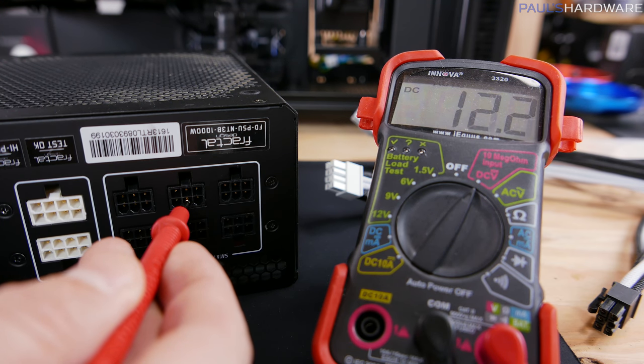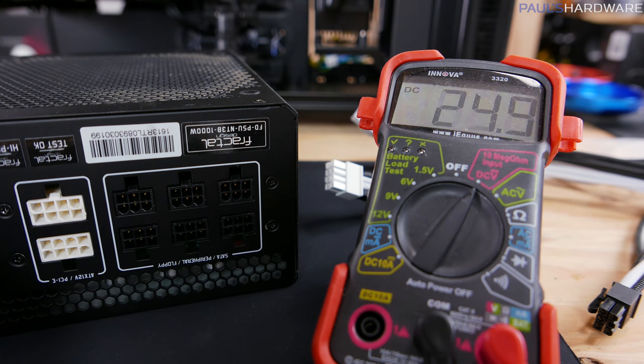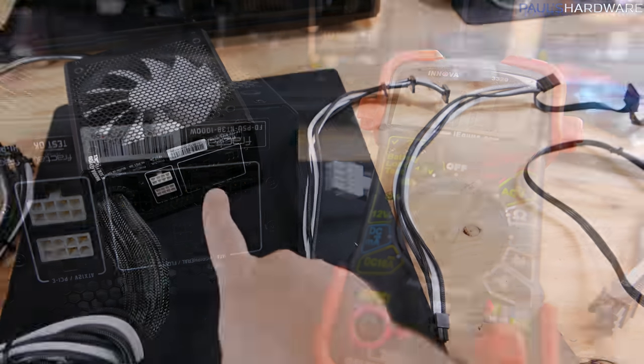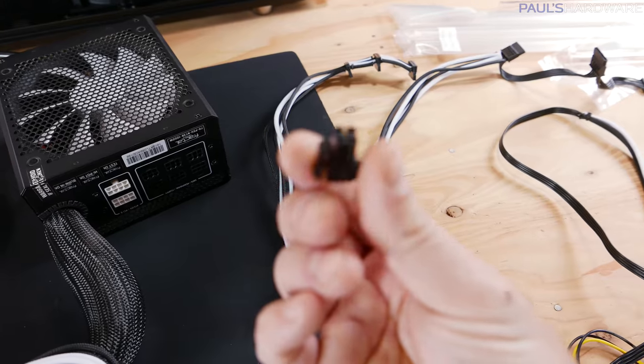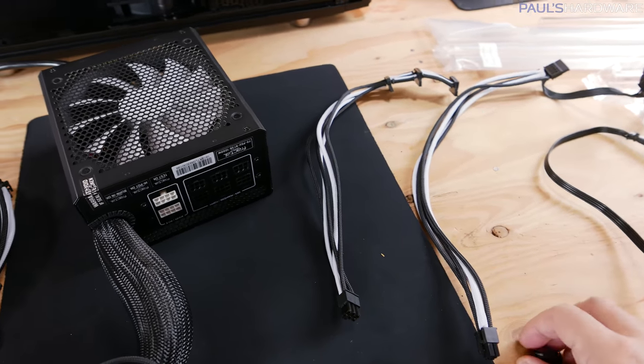That's a no juice. That's probably just another ground, or it might just be a dummy not connected to anything, because right now we're getting like 30, it's climbing. All right, this is getting beyond my knowledge of explaining that, but basically I can't use that. I can't use that bottom extra connector. The upshot here is that I'm gonna need to use two of these peripheral outs to go into my single 4-pin power connector, but that's okay.